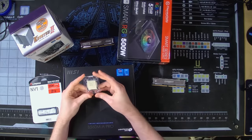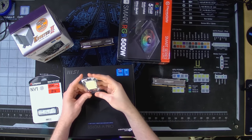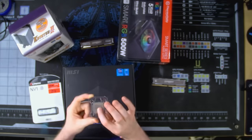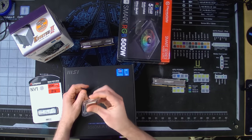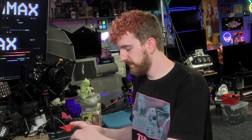The platform we're building this entire build off of is Intel 10th Gen. I had an Intel Core i5-10600K laying around — I was actually about to give this away, and then was like, I could use this for that purpose. We're going with this because it's new enough to be super fast and last a very long time in terms of not needing to buy a new computer anytime soon. 10th Gen is rock solid, even if 12th Gen is out. It's an i5 with an iGPU, so we don't need a dedicated graphics card right now, which is huge in terms of sound, power requirements, and extra points of failure.